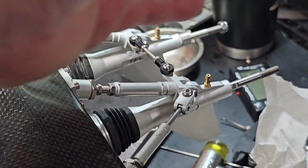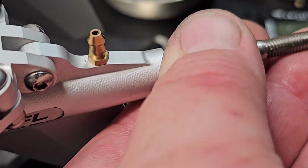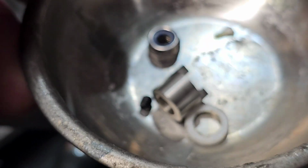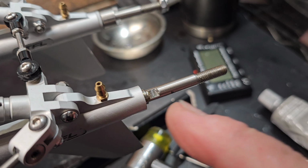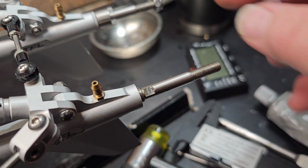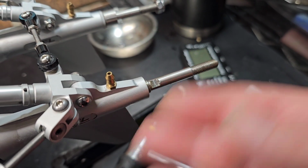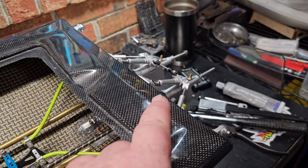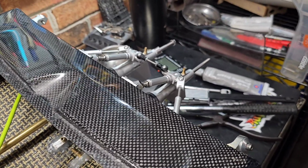Okay. I took this drive dog off, and by the way, there was no Loctite whatsoever on the grub screw or the drive dog. So if you guys have this boat, or are thinking about getting it, you may want to Loctite that drive dog on, both of them. Loctite the grub screw into the drive dog so it doesn't back off mid-run or anything. Because they're going to be turning some huge props, 67/16, so make sure that's ironclad. You know what I'm saying?